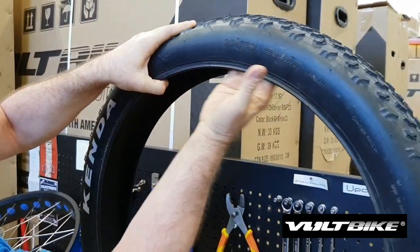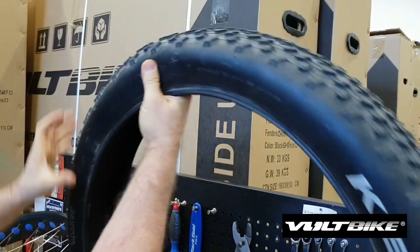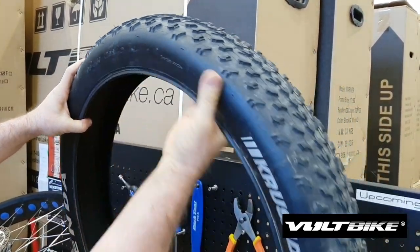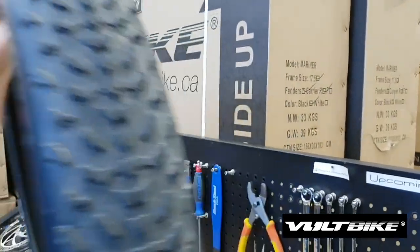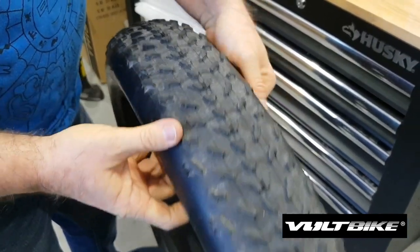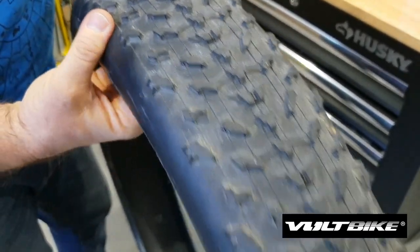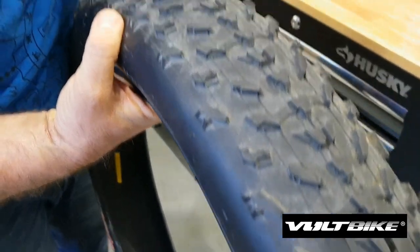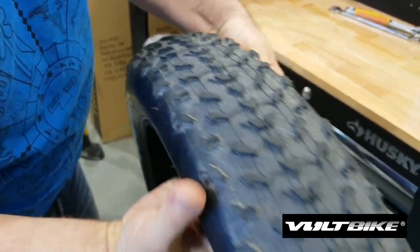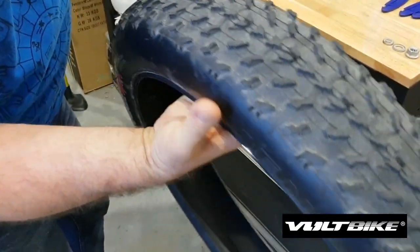At this point I don't really feel anything and I don't see anything on the tire. You can also visually inspect the outside of the tire — that's another way to tell if there's something lodged in the tire which could have caused the flat. Lots of times you can see it; lots of times after they do the damage they fall out and they're not there, but you still have to replace the flat tube. This one looks pretty good and I'm comfortable putting a brand new tube back in, not being worried that there's something that will damage the new tube.